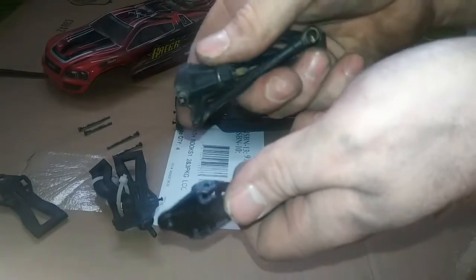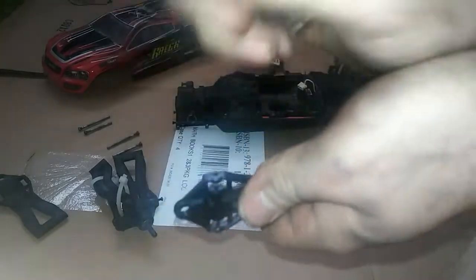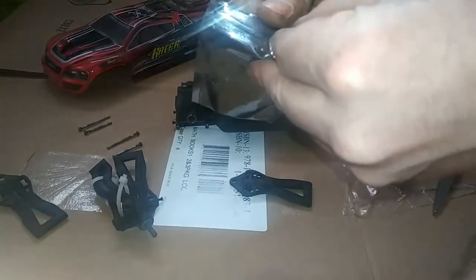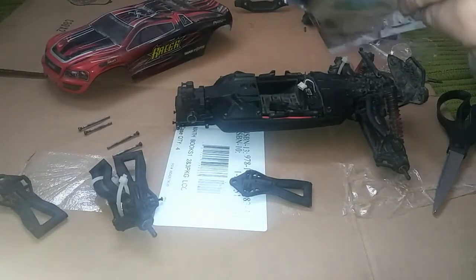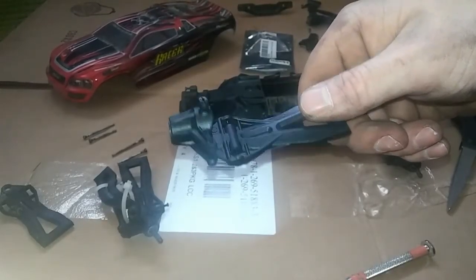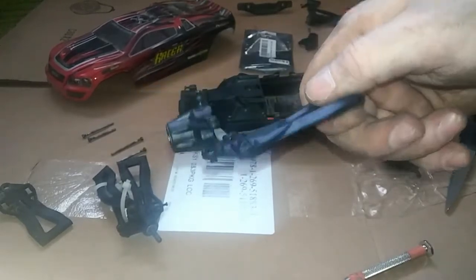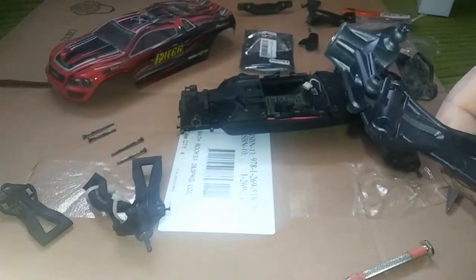So I got the brand new lower arm with the old joint cup — see, it shouldn't just come out like that. So it leads me to believe that it is actually this joint cup. Using the new ones here. So it definitely was the joint cup. I went ahead and put both the new parts together. That lower suspension arm was kind of faulty and I didn't want it to hurt the new joint cup, so I just threw those on. I'm going to do the same thing to the other side and show you the results when we're done.